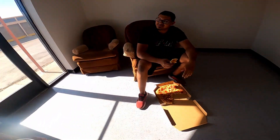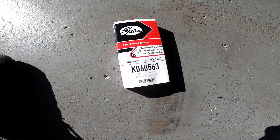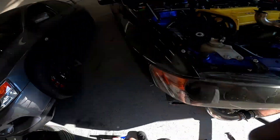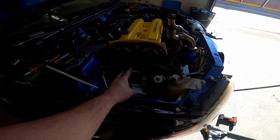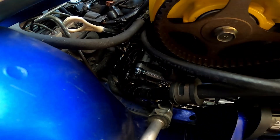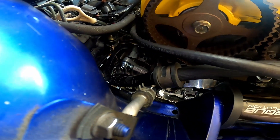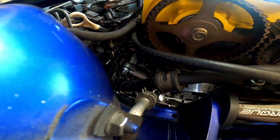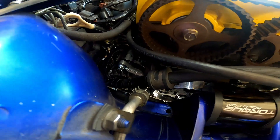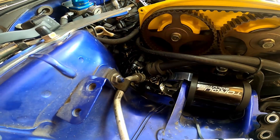So we had to go back to O'Reilly's — K060563. That is the belt we needed with the billet idler pulley, power steering, the oversized water pump, and the alternator mod. That's what it should look like — it should not be extended out very far on both sides. Both sides should have minimal, if any, stretching outward. Once it's properly set, you should never have to touch it again — that's a promise from EvoSpec if it's done right. Totally stoked, really excited to see what this thing does.